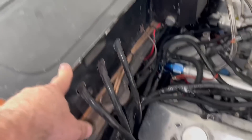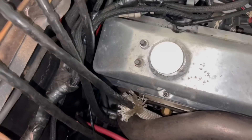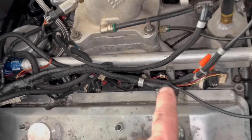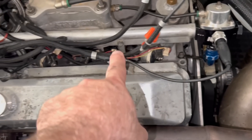The coils — I've got my coils mounted in here, with the coil wires coming through the firewall. One of the things that Holley wants you to do is take the negative from the coils and attach it directly to the head that is being fired. Right here, that is the coil grounded directly to the head on this side, and I've got the same thing on the other side. I have seen people put them to carburetor studs, and sometimes it works, sometimes it doesn't. If you put it to the carburetor stud, you've got an intake gasket preventing the aluminum from directly contacting the aluminum on the head, and the only thing making contact is your intake bolts.